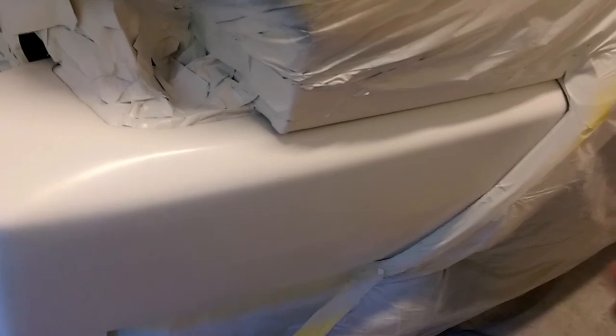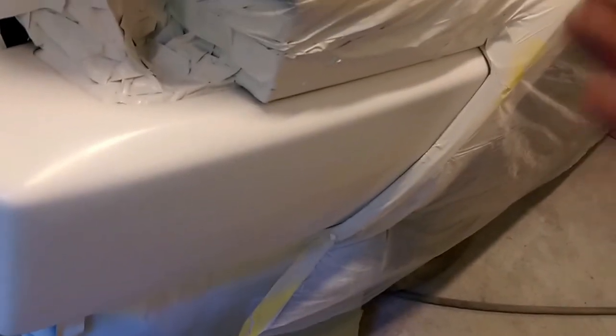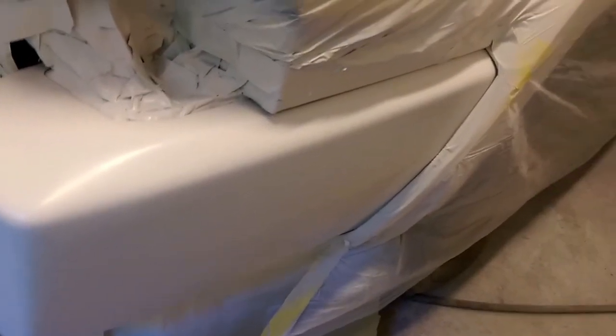Guys, here's a repair spot. It's looking great. This is after the third coat of base. We have everything blended in, then we are giving it the actual flash time it needed, and then we're going to lay a clear coat.